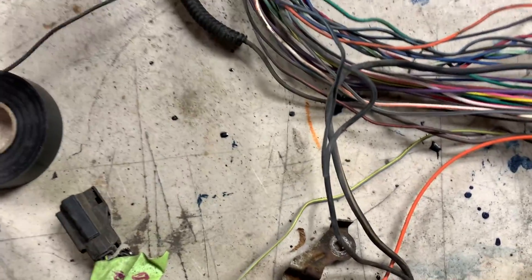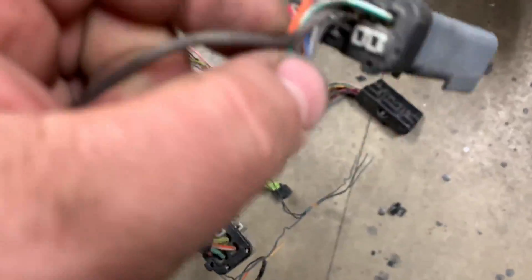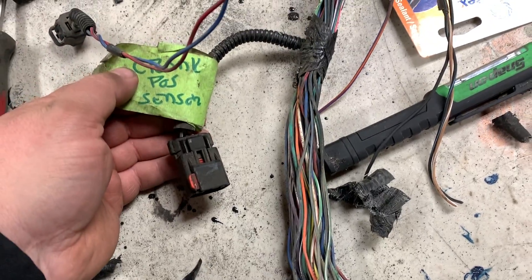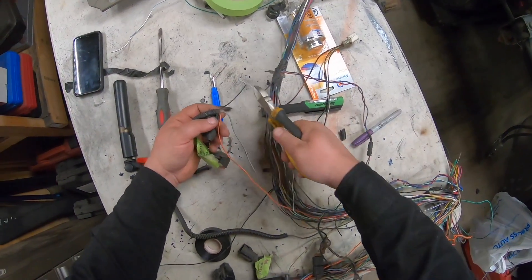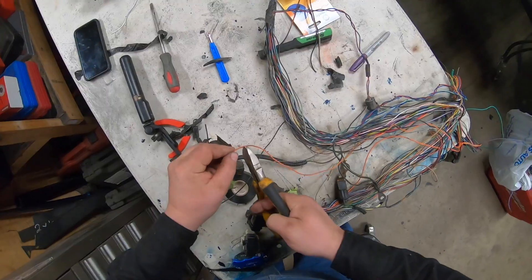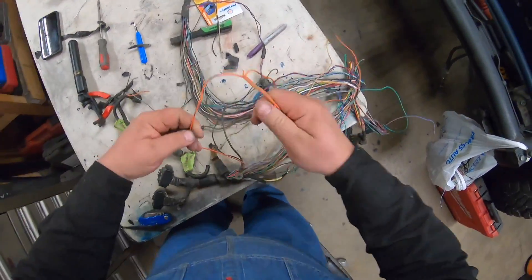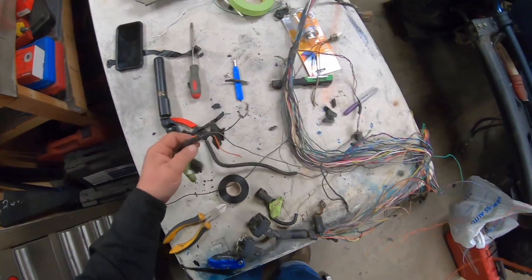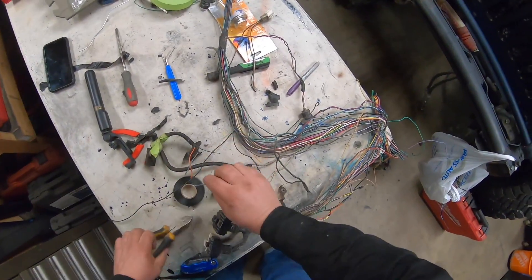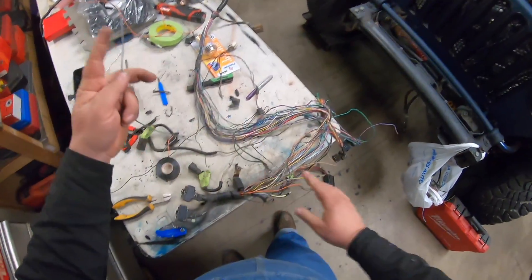My oil pressure — I need that one there. This is my ignition, and that one is traced down — it's a brown wire that goes into there. The last one we're going to pull out for right now is the crank position sensor. The crank position sensor has a ground right there that I'm terminating. This orange wire I believe is my 5-volt wire from the computer — if I pull that back it goes right into the harness. The wire I'm probably going to need for the tach emulator is this one right here, which I'm going to tape, mark, and verify afterwards.